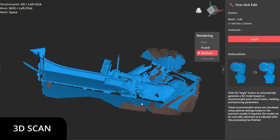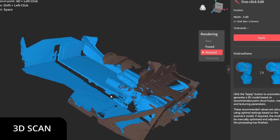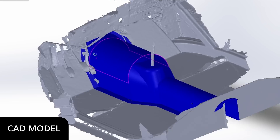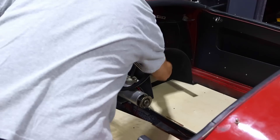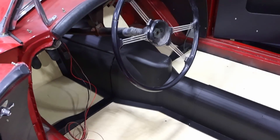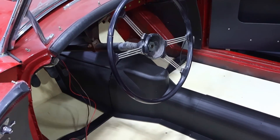I'm trying to use my new workflow, which starts with a 3D scanner. I was able to get a pretty good scan, then I took that into CAD and modeled the transmission tunnel to go right around the transmission, only protruding where we really needed it. I then sliced it up in 3D printing software and did a 3D print. I just made some parts for the tunnel, so let's put them together. I think that looks pretty good — we'll go ahead and make this one piece. I also need to cut a hole for where the gear shifter is going to come out, then make this ready for fiberglass.